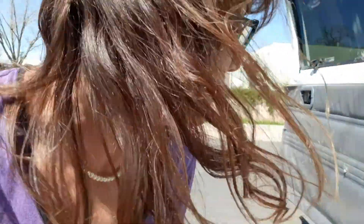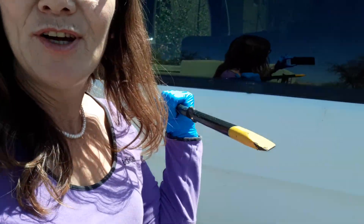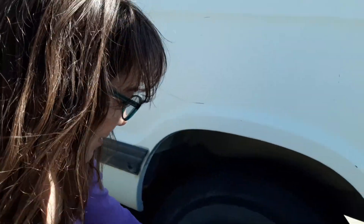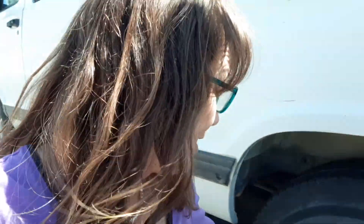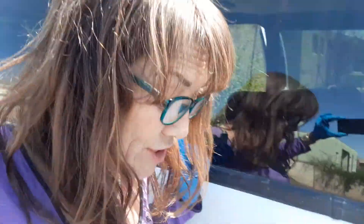Before you jack it up, you want to loosen your lug nuts. I already sprayed them. There was a cap on here that I removed with the sharp edge of this crowbar, which happens to be set to the right size for my van. You've got to make sure you have a crowbar with the right size for your lug nuts. The way you loosen them when they're tight is to put the wrench on and use your foot to push down — counterclockwise.